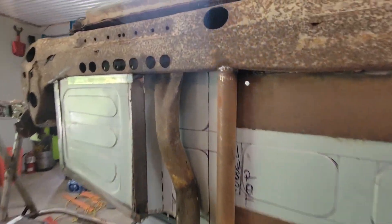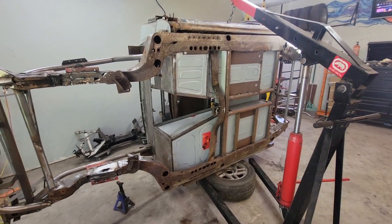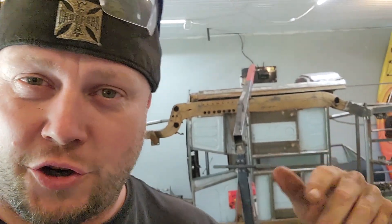So this is before. Basically I just had to knock all the rust off of it to be able to put this rust converter on it. There's still rust on it - that's just the color of the metal right now. I knocked off the surface rust, anything flaky, anything that's going to be dusty or potentially ruin the paint or flake off as soon as any paint gets on it. That's all gone. Everything that's left is nice, good, and solid.